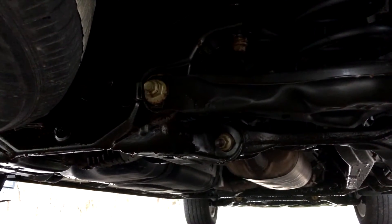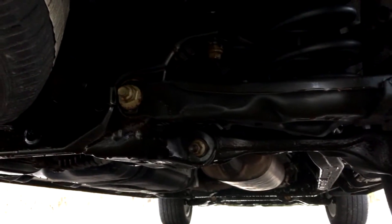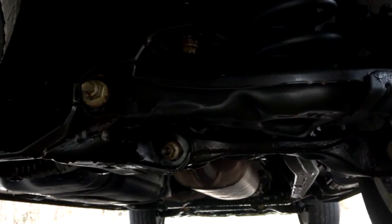When it dries out it's gonna darken up a little bit but it still has this amber tone to it. I tried to get the frame as much as I could. You don't really have to spray the wheel wells because it's just plastic — you're trying to protect the metal parts. Hit the key points: the frame, cross members, and the bolts. Sorry for the poor lighting, but this is what it looks like when it's done and starts to dry out. After it dries it'll have a darker tone to it.